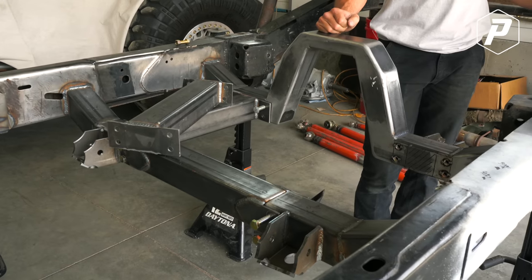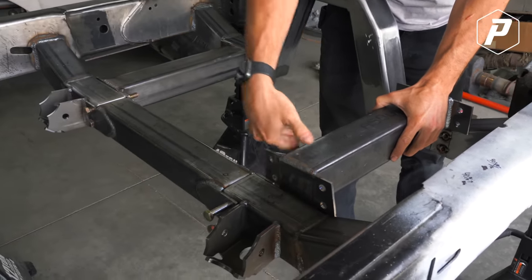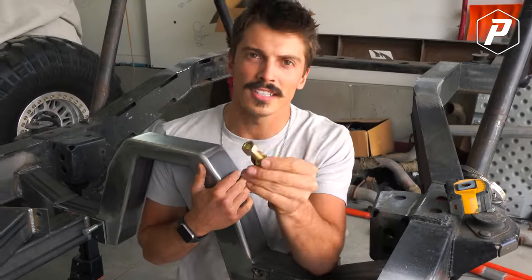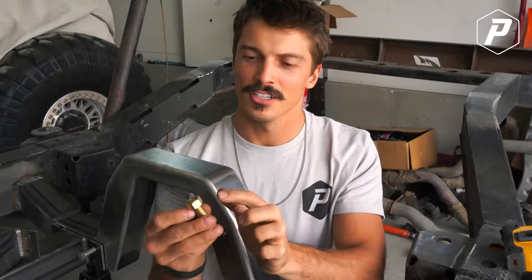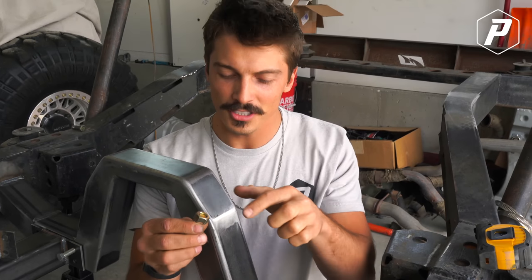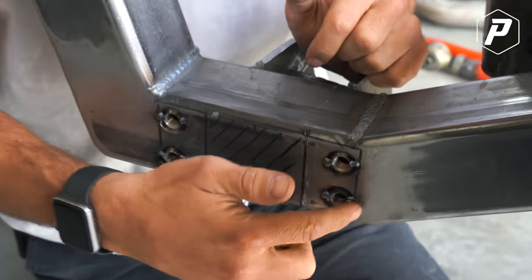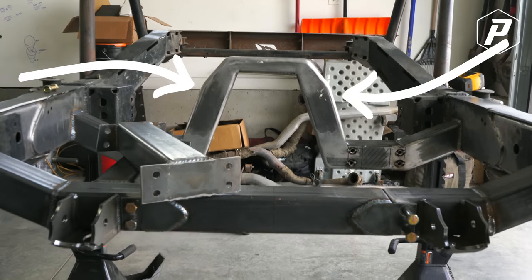In one of the last videos you guys saw me and Caleb make this cross member right here. This week I was able to cut it in the middle and make it removable, as well as add two more big gussets so that when force is applied to the front, it distributes the force to the back, therefore making it stronger. The problem I was having is I can't put a through bolt through these because it hits this, and all of the weld-in inserts I found don't sit flush into the metal. So what I did was I went and bought a bunch of half-inch nuts, ground all of the hex off so they're perfectly round, put a chamfer on it, drilled the hole, and put them in. So now all we've got to do is weld all these, grind them flat, and then I can just thread bolts straight in. I don't have to hammer a bolt clear through, and it actually worked out pretty good.